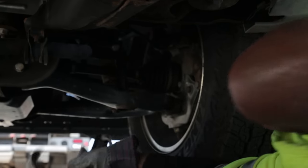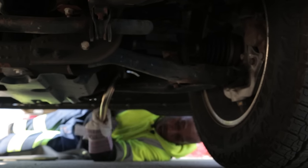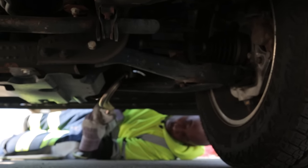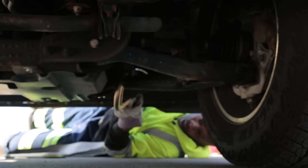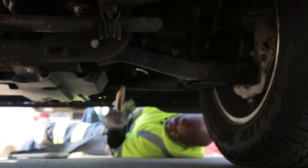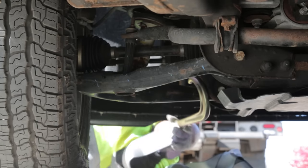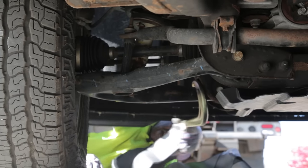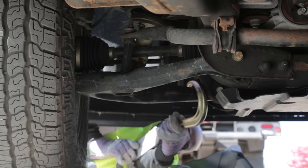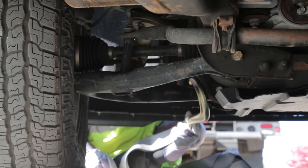The safer way is right here at the front of the control arm. This strap is rated at over 5,000 plus pounds, which means there is plenty of room for the axle to clear from underneath the vehicle. The front of the control arm is clear from every boot and every link, even if it slips. That's a safe hook right there.